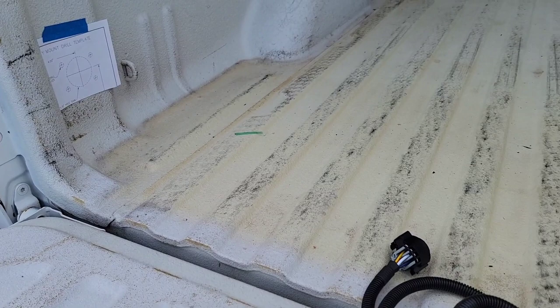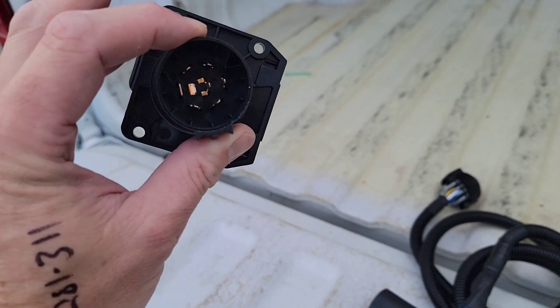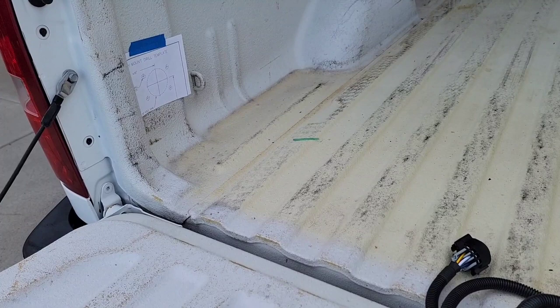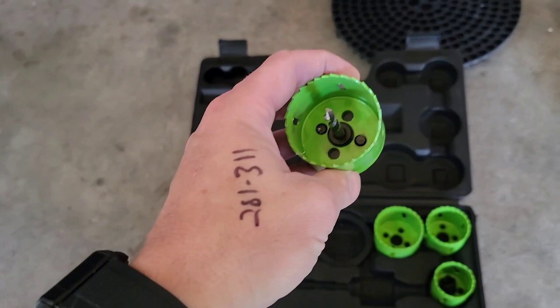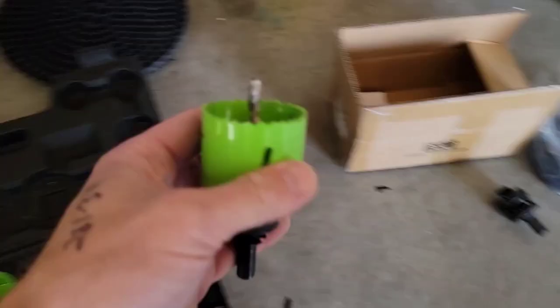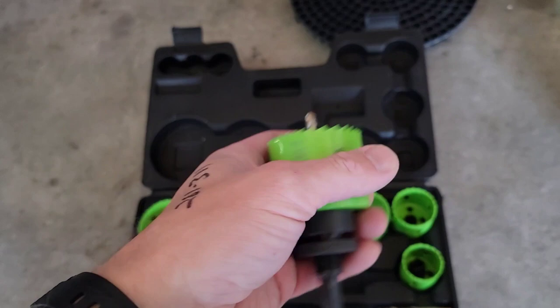I'm going to make a tiny pilot hole for these self-tapping metal screws — itty-bitty. I'm mainly using the Ford template to line up the holes for this and for the 2-1/8 hole saw. I bought a 2-1/8 hole saw entire kit off Amazon — super cheap, done excellent in service. Keep in mind you need to make sure you get a metal bit, not a wood hole saw. So here's the kit — 2-1/8 is the hole. If you guys need that template, I'll put a link in the description. These are actually pretty decent. I bought some bigger ones too. For the puck system, those work great. I'm going to get several holes out of these bits — it really didn't even take the green paint off when I used this last time. The Ford bed was aluminum so it cut through a little bit better. We'll see if the steel wears these down. But it came with the arbors, came with the locking stuff — pretty much a standard drill.